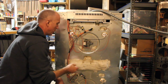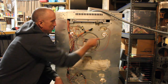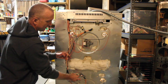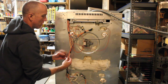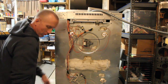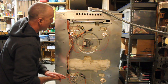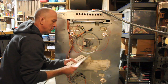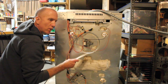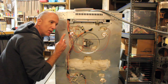There's a few other wires back here: the white common wire, the black wire — these all have splices because they're daisy-chained between everything. Then you have your purple wire which connects to the thermostat sensor, and your main red power wire which connects to the transformers on the upper and lower oven. That's really all that's back here outside of the wire harness mesh. Very simple configuration, not very complicated. Your oven should also have a wiring diagram — that is normally in the top part of the oven inside the metal casing behind the computer or controls.